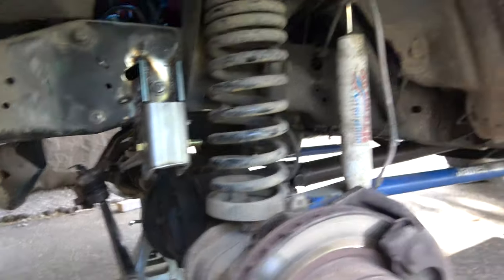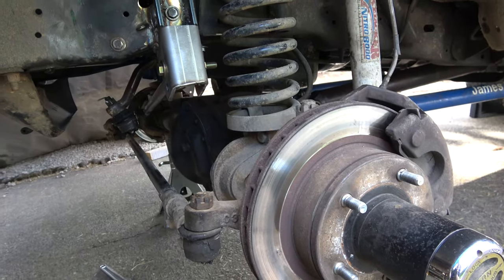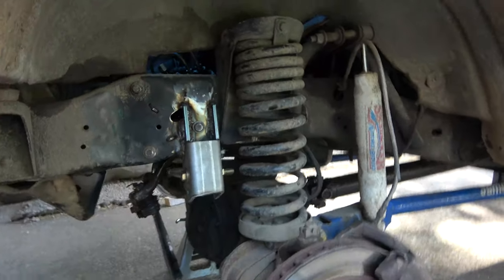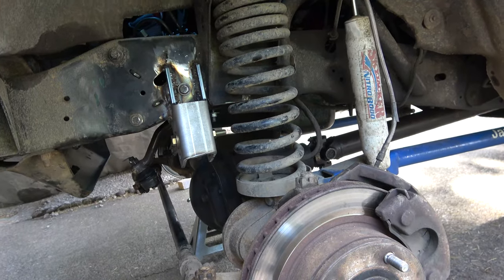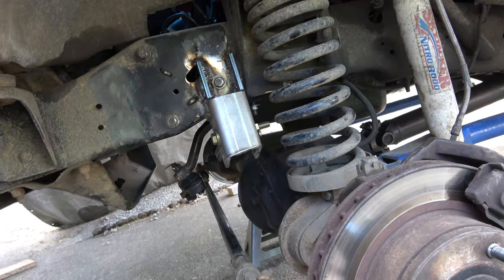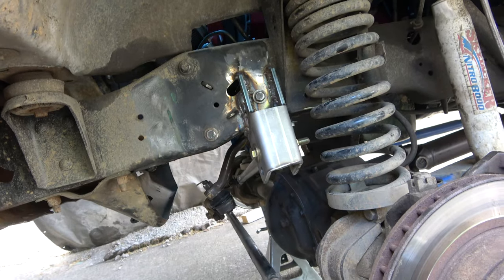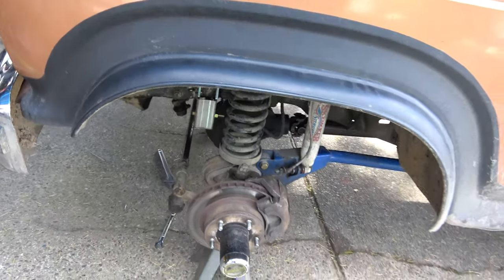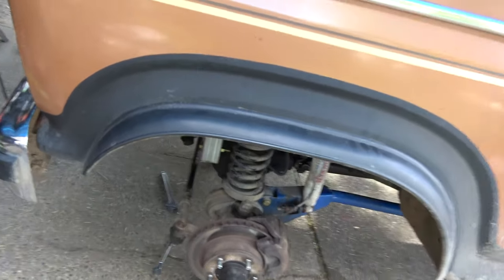When he turns the steering wheel, the wheels actually turn and the truck doesn't go side to side. We'll test it properly once the wheels are on and there's load on it to see how it does, but I don't think it's going anywhere. I'm going to undo the fastener for the upper track bar mount, brake-clean the outside, and paint it up. That's pretty much done — just got to paint it, snug everything up, and hopefully the axle doesn't wobble anymore.